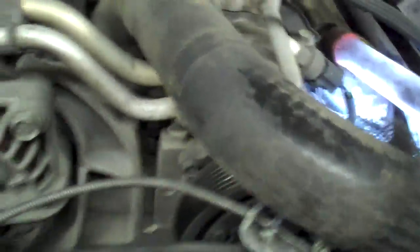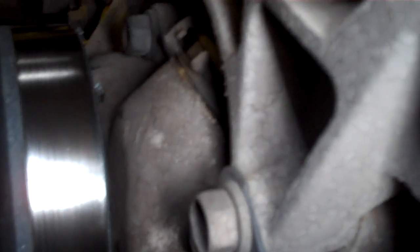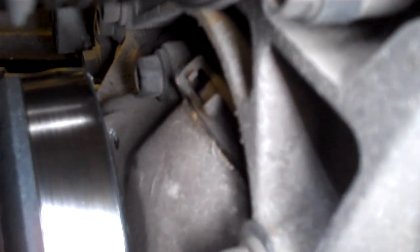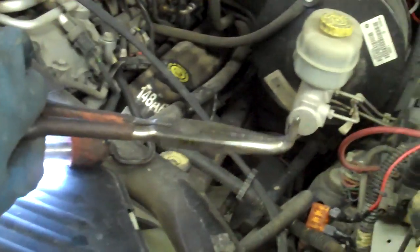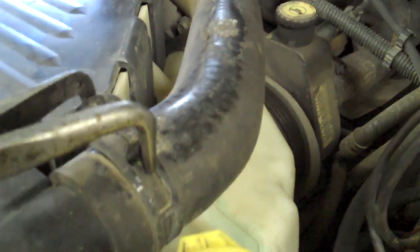The next thing I'm going to do is start pulling hoses and hose clamps. On this one, the hose is directly connected — the lower radiator hose goes to the pump. There's another hose on this side and a little spout you've got to work out, and then there's one that's kind of tricky that comes out the top. I'll do that one last after I've unbolted the water pump and start pulling it out. For doing hose clamps, one of my favorites is to use a long pair of needle nose pliers. Put it on the top, pinch them, rotate them, and work them back.